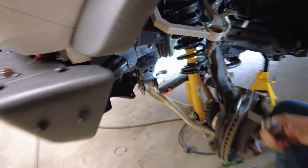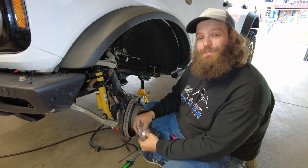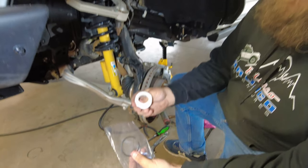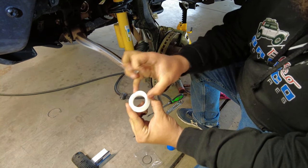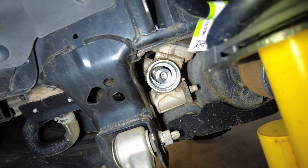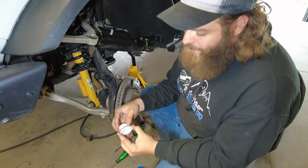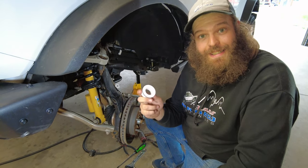Just like that - Frankie, the man! We get to finally put in our Bronc Buster bushing. It comes with a snap ring and the bushing. If you look at it, there is an oblong side on it, and if you look in your steering rack there is an oblong hole in there as well. All you got to do is kind of mesh those up when you slide this in, and when you tap it in it will seat right into place.